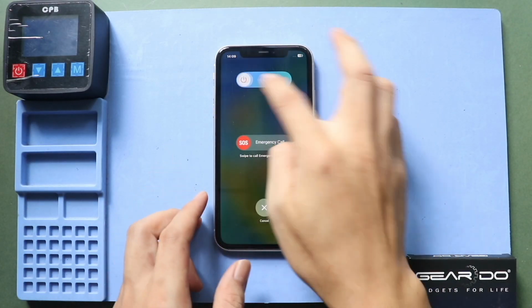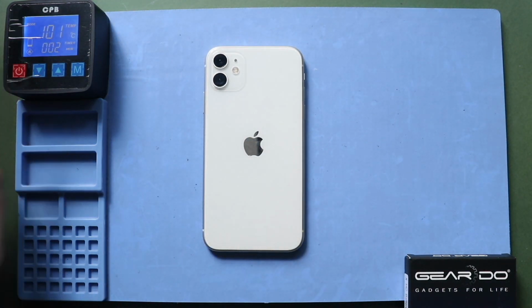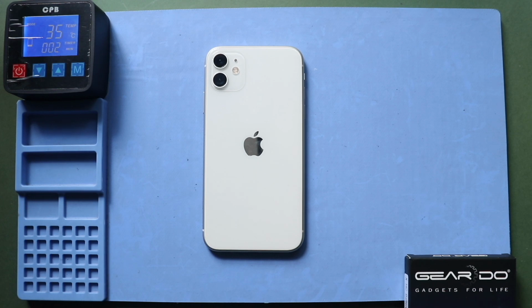Today we will show you how to replace the loudspeaker ringer on the iPhone 11. Before starting, we need the right tools to proceed with the repair, which are listed in the description. At first, turn off the phone and remove the SIM tray. Next, take out the screen from the body.